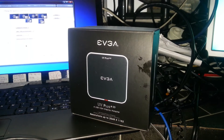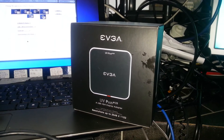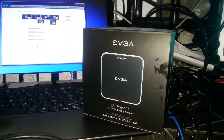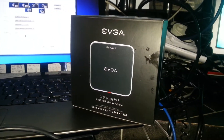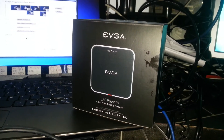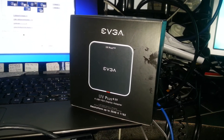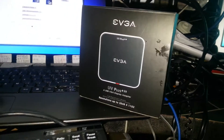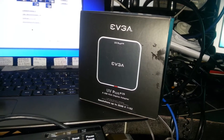What you've got to remember is that you've got to put the drivers in before you plug the device in. Once you've done that, shut your machine down, just plug the devices in and it will start up. You'll notice in the beginning, while the computer does some calculations to find out what's happened, you're going to get a bit of screen swapping about.